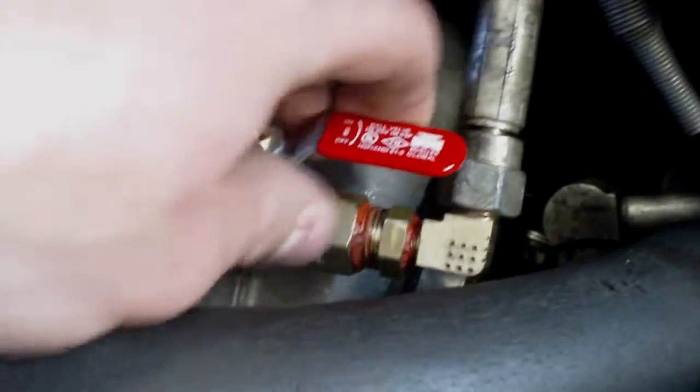About to give it a start — all I have to do is adjust this valve back and forth and it'll adjust the pressure gauge. I started the car up and there are no leaks, it's running well. Right now at cold start it's reading about 55 psi. I want to get that number down to about 15 or 20 at idle once the oil warms up. If it's still at 40 at idle, that's too much pressure.